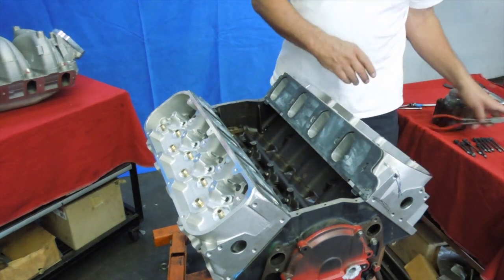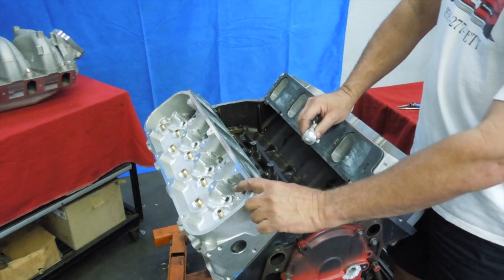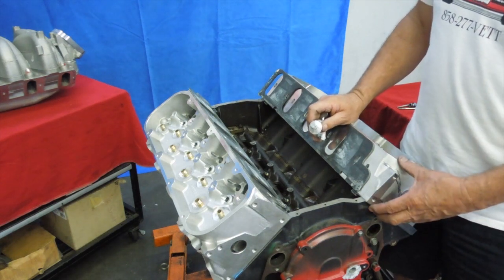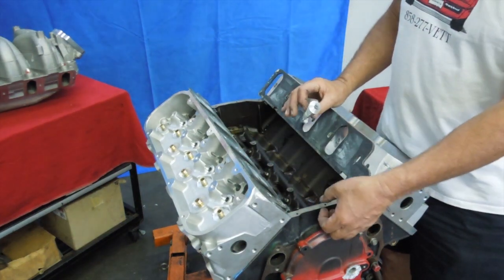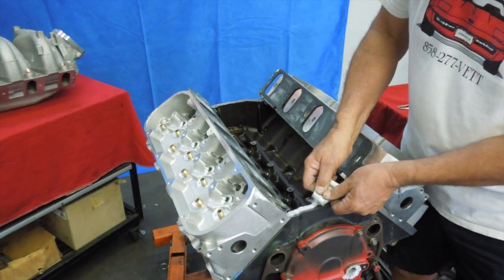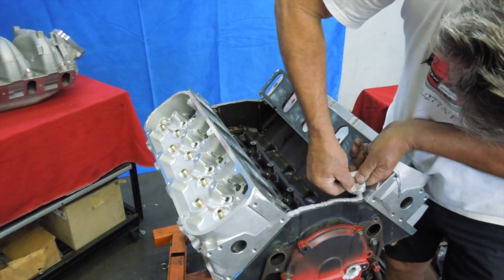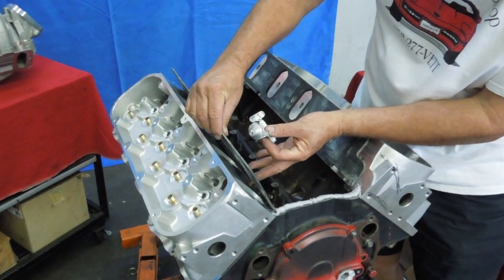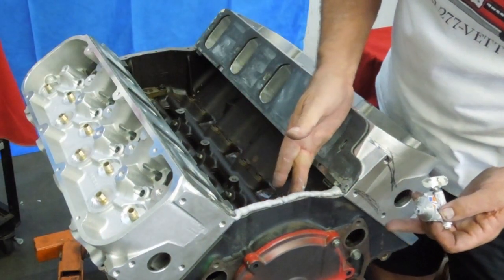After we've got the gaskets on, my favorite sealant is Permatex Gray — it works really good for the front. We don't use the rubber gaskets because depending on whether the block has been decked, the head has been milled, or whatever thickness gasket you have, it moves the head position. As you move this tighter, it raises the manifold. So it works really well to use this gray silicone sealant. Bring a little up on this side and this side, because when you take the gasket, you want it to sit down into it.